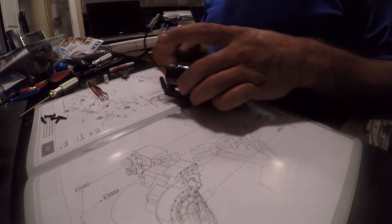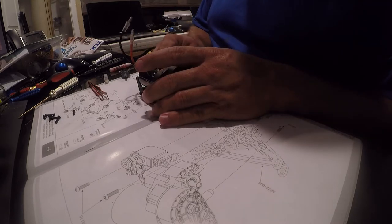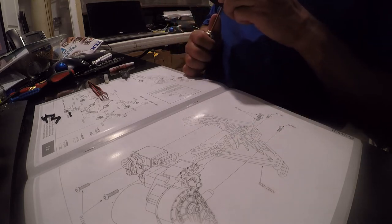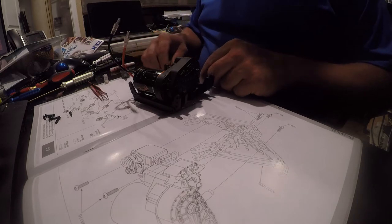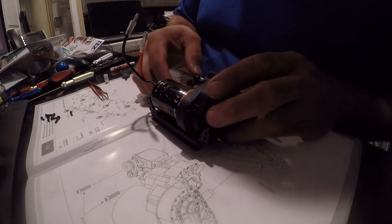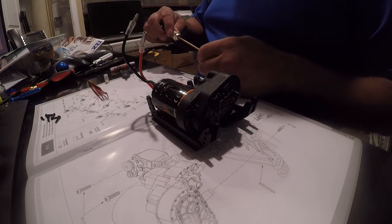Now we need the transmission, where we're going to attempt to install. So we'll orient this. And then we're going to spin this, because we're glutton for punishment. Four is the longer one, and we want the longer piece towards the transmission, and then we're going to slide that through there, and then this lock nut gets thread locked, but it's the pin as well.